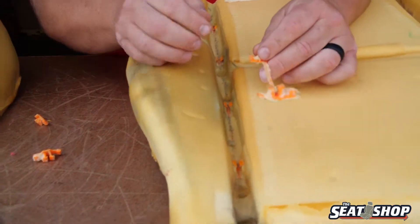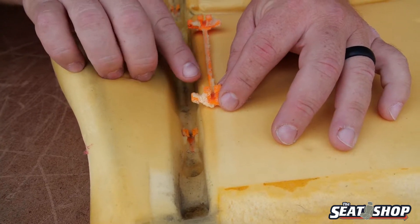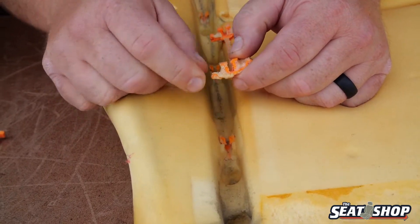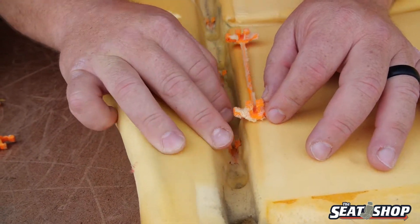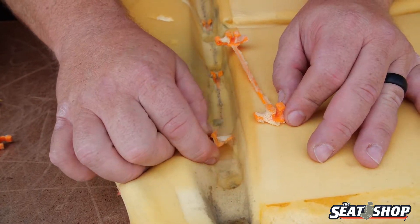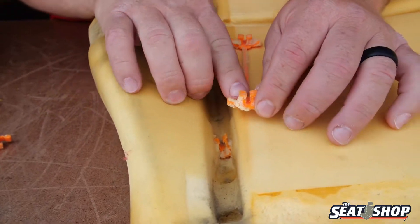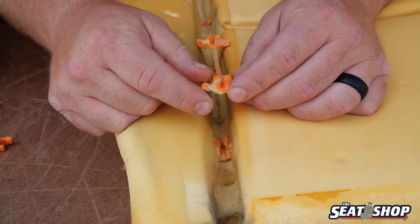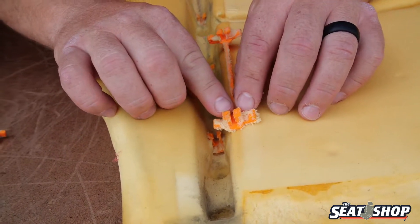There are little plastic tabs that are embedded into the foam. On the underneath side of the cover, there's a fabric strip with a piece of plastic on the end of it that hooks into this little channel. You spread this apart when you're pulling it up trying to take the cover off, but when you're putting the cover on, it just pushes down and clicks into place. Two things can happen: sometimes this corner can be peeled up — this whole clip can be starting to pull out of the foam. Or at the bottom of this plastic piece, it can crack so it doesn't hold together real tight, and when you push the clip from the cover down into the channel, this doesn't hold it and lock it into place.